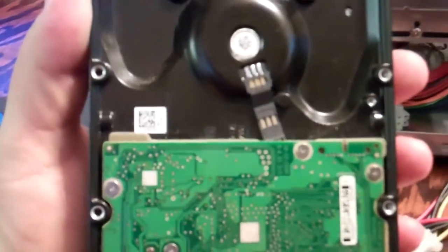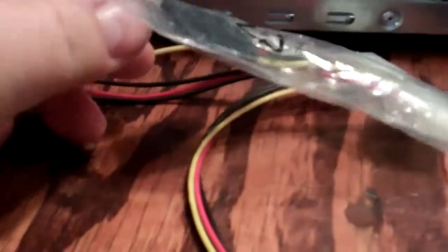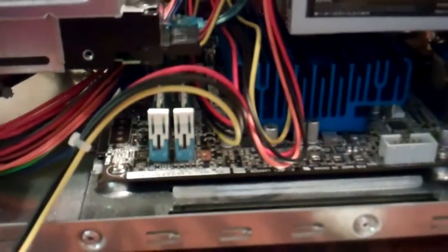My intention is to mount it using the existing four screws on the bottom of the hard drive, mount it to these brackets, then line up the holes on the base and drill new holes to run screws through to anchor the brackets in place. I'll connect everything using an existing power cable — being that it's SATA, I've got a Molex to SATA connector — and an extra SATA cable for data transfer to connect to the Mini-ITX motherboard, the AT3IONT-I made by Asus.